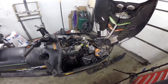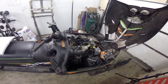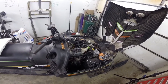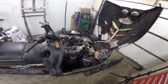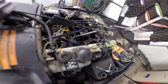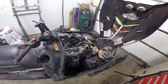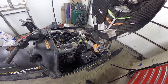Finally did some digging around and remembered that when I got the machine, the wires for the — what do they call them — magnetic safety switches on the carbs had been clipped. Kind of a head scratcher. Talked to a few people and everybody says, oh yeah, that's an easy bypass. Well, if you look at my wire harness that is melted and has wires exposed and is just a mess, might be a little more difficult of a bypass for me.